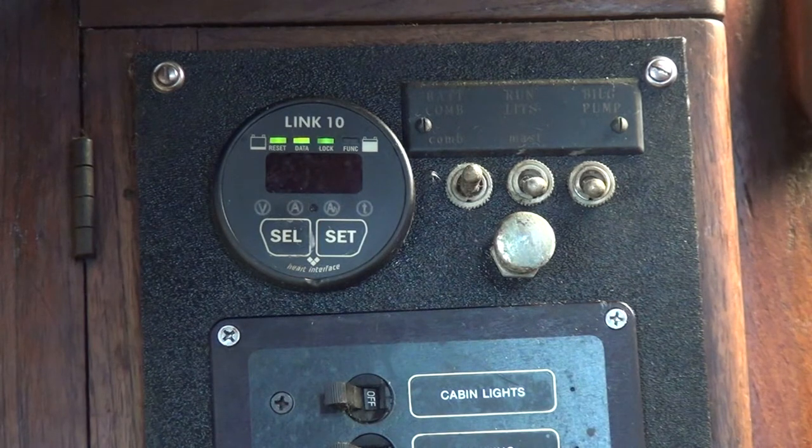For any type of battery you're likely to have — meaning lead acid or gel cell — you do not want to drop the battery usage below 50% of its capacity. To do so will damage the battery if you do it more than a few times. It won't kill it the first time, but the fewer times you do that, the longer your batteries will last.